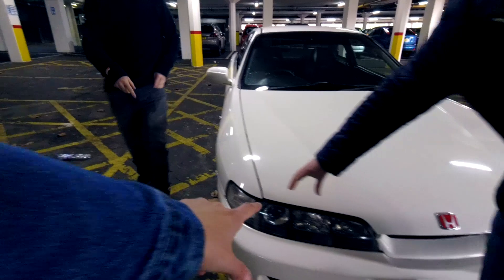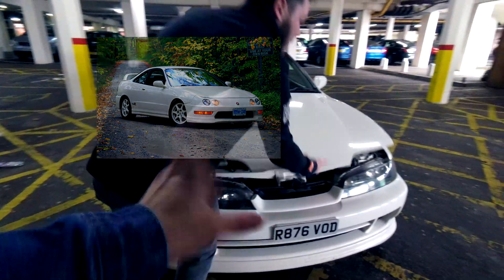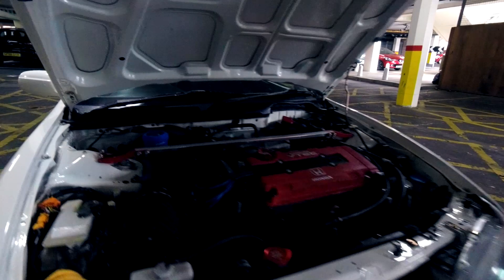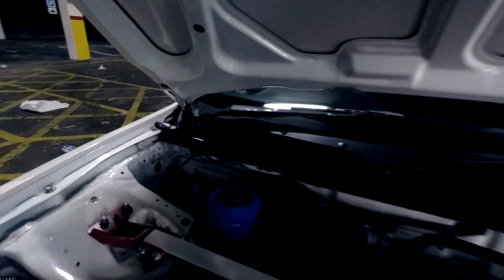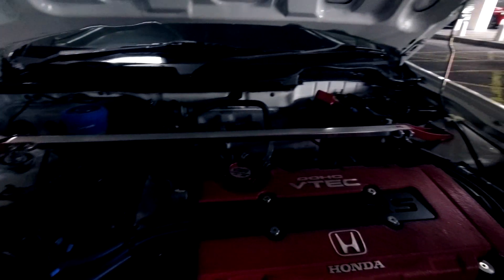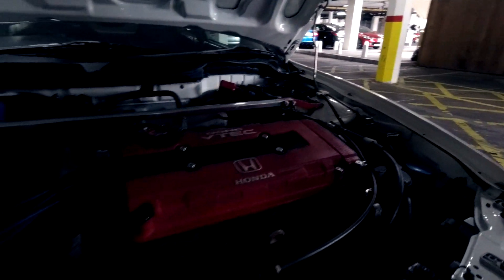What about the engine? The headlights are bigger on the JDM — the UK ones had twin lamps that covered the whole headlight, so I hadn't realised that was the difference between the Japanese and UK versions. There's an S2000 clutch master cylinder — normally the reservoir is on the strut top but on the S2000 one it's on the pedal, under the bulkhead. It was leaking so he replaced it with that. It's also got a 4-2-1 manifold — looks stainless — which was on it when he bought the car.